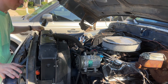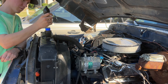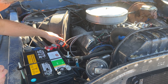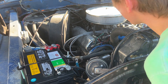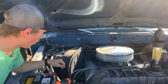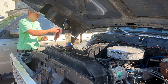It takes a while before that automatic choke kicks off. See how it's starting to get white smoke back there? I just want to see how hot it is with this laser. 141 degrees on the head. That could be oil but it doesn't really smell like it; it's kind of hard to tell with the fan blowing it back. We later discovered this white smoke was caused by transmission fluid leaking out onto the headers and burning off.